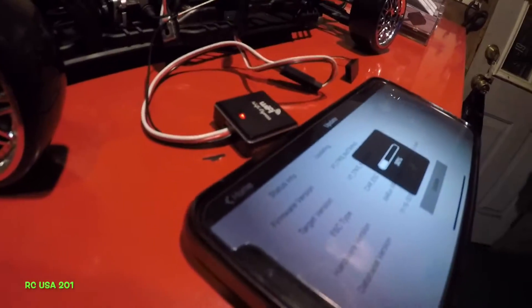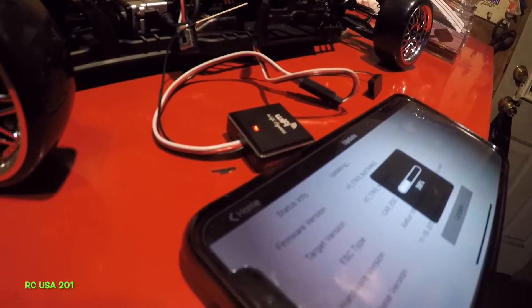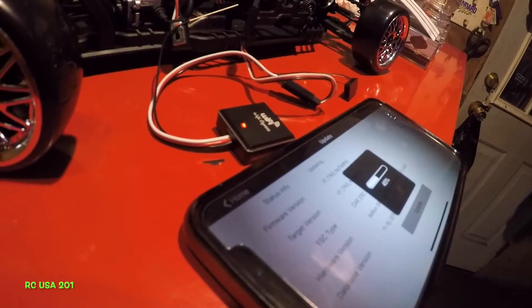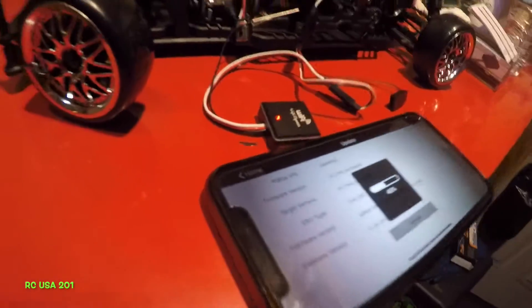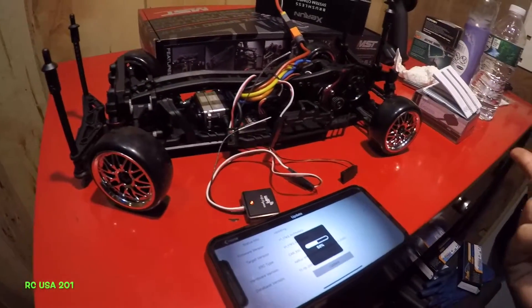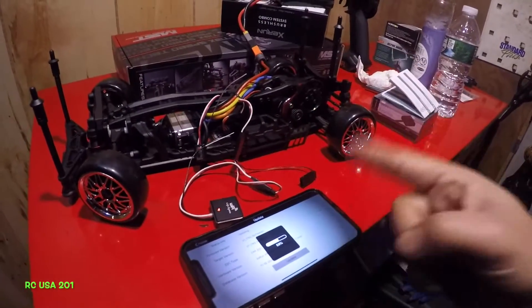The Hobby Wing Express — some of the cars you can connect it the same way. That's how you're going to put the values into that little ESC. But on this car, all I had was my throttle — the motor is backwards. So I need to switch the direction of the motor, because when I press the throttle it goes back.